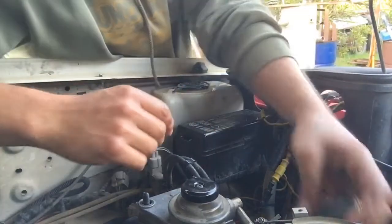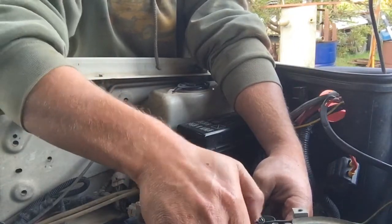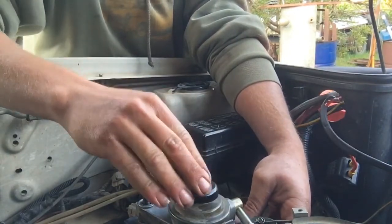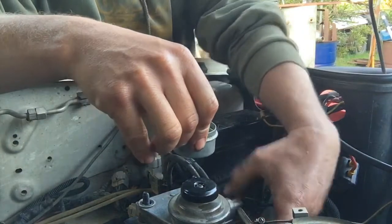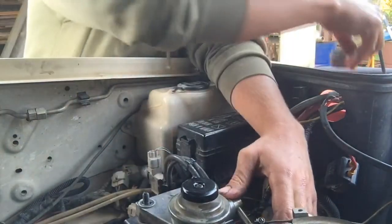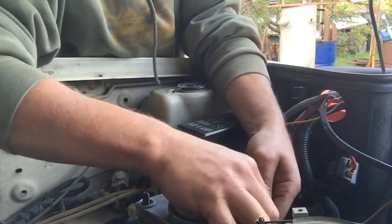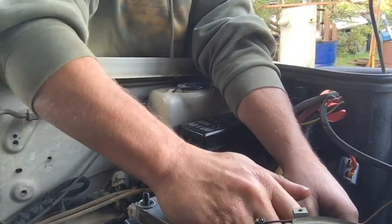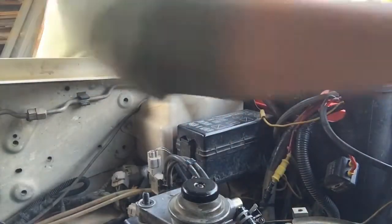It's got an old bearing cap. Let's get that pumping and get some fuel in the system. I feel like you're getting a bit of resistance now, which means the fuel must be coming close. There it is. I'm going to slip that hose on there. Let's make sure they've got pretty snug connections. A couple of pumps for good luck, just to pressurise the injection pump. And don't seem to be having any leakage, which is good.